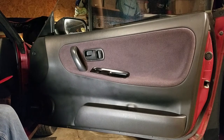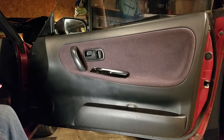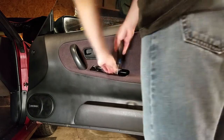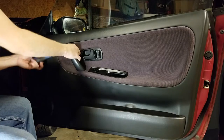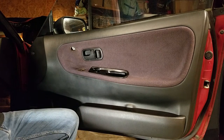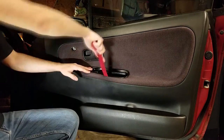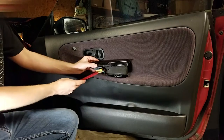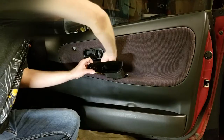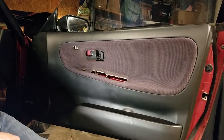The last one is right here behind this little plastic nub. Just use a trim removal tool, pop that out, and undo it with your screwdriver. Once you have undone those three screws, you can go ahead and pull out the door handle with a trim removal tool, as well as the little pocket that has a screw in it. There's a little plug right here — I'll undo that plug and pull this piece out. Once you have all that done, you can go ahead and pull the rest of the door panel off of the door itself.